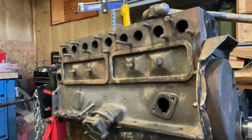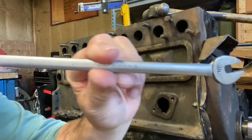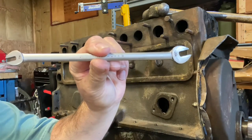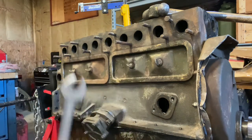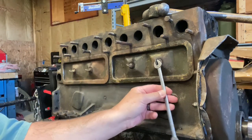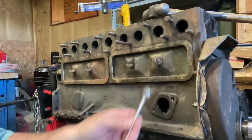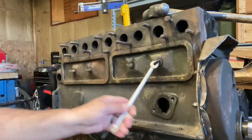I'm going to use my Snap-on B1351 — it's really just a wrench for the eccentrics on the Willys brake system. That little quarter-inch end right there is enough to get in there and help that out. I don't want to bite it with a pair of pliers and mar them up. Well, that didn't take much.